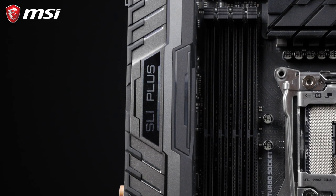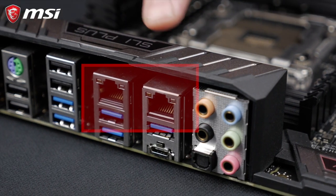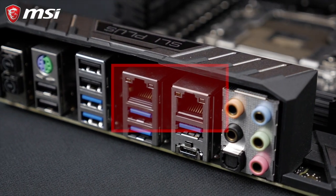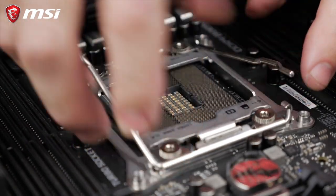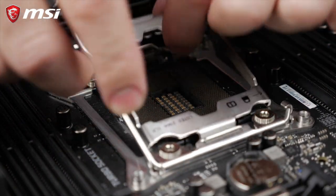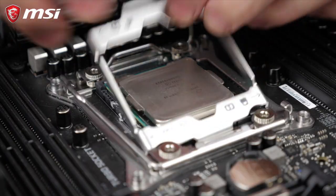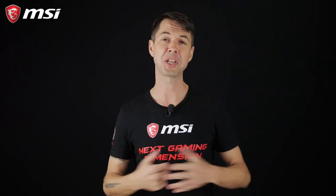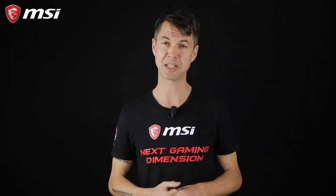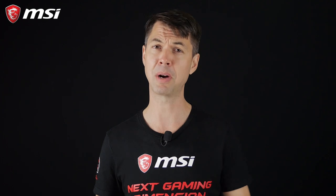This is a motherboard built for multi-GPU support that has dual gigabit Intel LAN ports and an impressive amount of USBs for connectivity. Our choice to go with the 10-core CPU is to keep the budget under control while still making it accessible to enthusiast content creators. Obviously, if you can afford it, the 18-core Intel Core i9-7980XE would be the ultimate chip to go in here. Note that for the X299 platform we'll be mounting the cooling a little later — you'll see why.